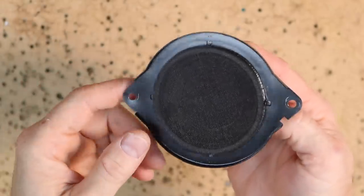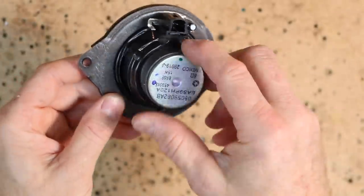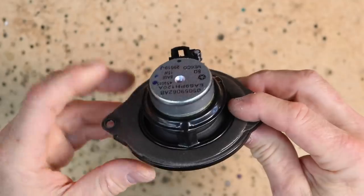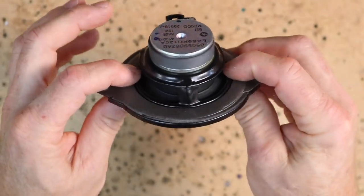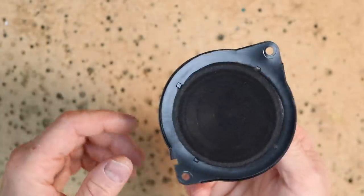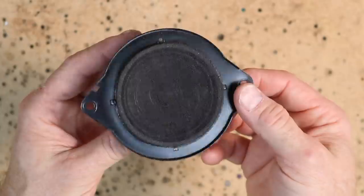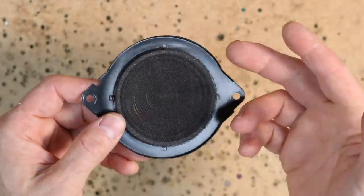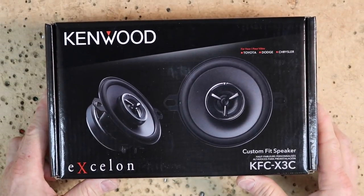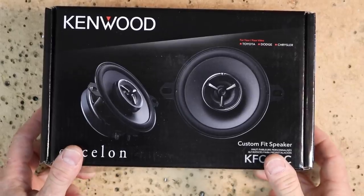This is what we're dealing with. Standard magnet, has a little capacitor on it right here. It's an eight ohm speaker. We're going to be replacing it with a four ohm speaker, which means these are immediately going to be a little louder. It has foam around the back side so that it goes in there and doesn't vibrate — it is a plastic dash. The actual driver itself is rather small, like a two inch driver inside of this big mount. We're not getting a lot of sound out of this, which is ironic considering this is the speaker closest to us and responsible for the most amount of sound. We will be replacing those with the Kenwood KFC-X3C's — these are the Exelons.